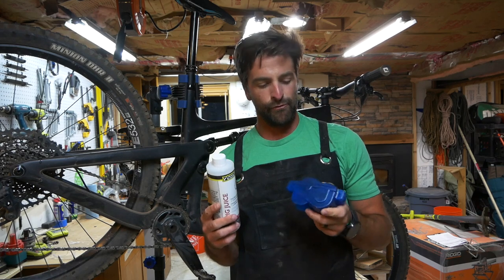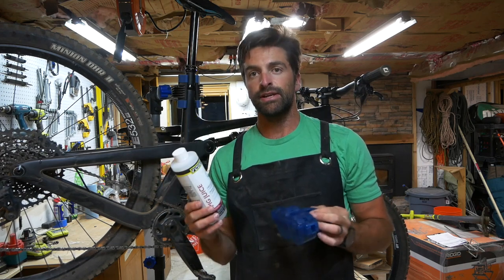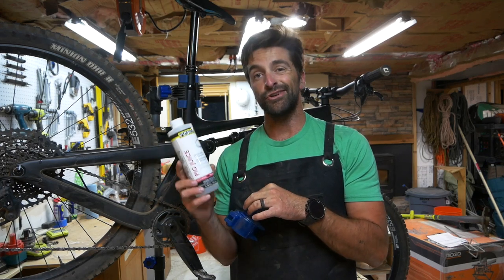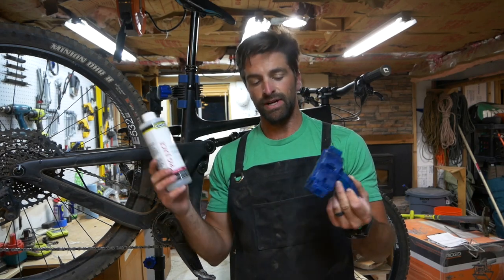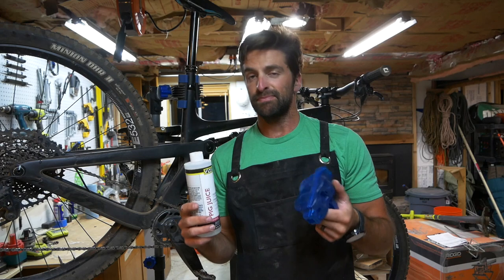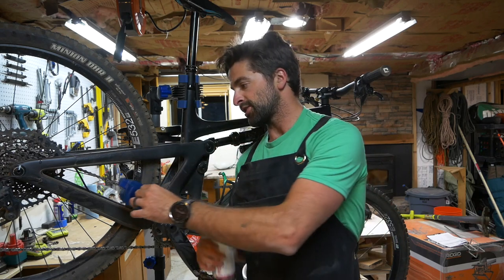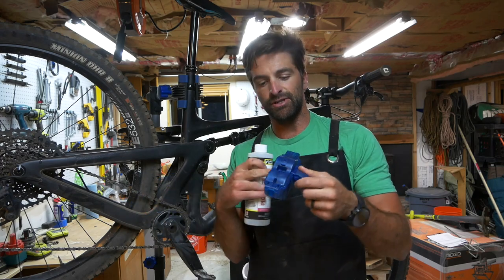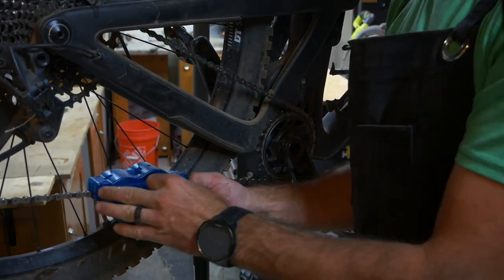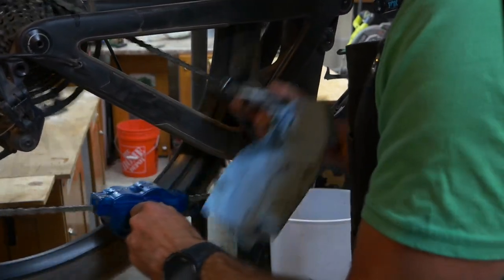Option two is a bit more intensive — you can't do this right before you leave. You'll need one of these little chain washing machines and some bike chain degreaser. You can actually use Dawn dish soap since it's a degreaser; a bike shop guy told me to skip buying the fancy stuff and just use Dawn. This chain washer is part of a whole bike washing kit I got on Amazon for $20 — best $20 I've ever spent. Fill the container with your degreaser or soap and run the chain through it — it has a bunch of little scrubby wheels inside.